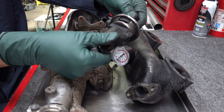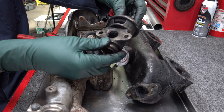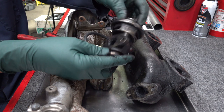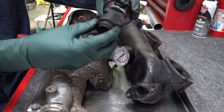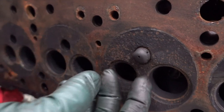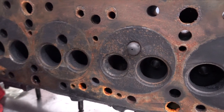We will leave the EGR unplugged for the remainder of Digby's engine test, because we don't want to spend time troubleshooting the vacuum controls that open and close it — that could also be a problem. So we're just going to put the better EGR back on, leave it unplugged, and continue with our tests. The next thing we're going to check is the pre-chamber. We're going to get the pre-chamber out on number three and thoroughly inspect it, which will allow us to look into the cylinder to see if we've got excessive scoring. We'll talk about theory first and then get to work.